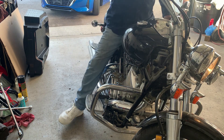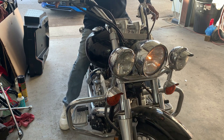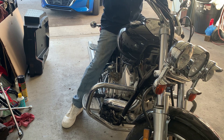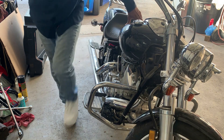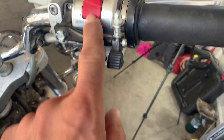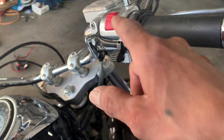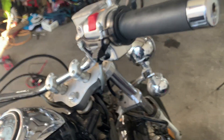I'm going to cut it off by putting it in gear. The reason I did that — I turned it off by just putting it in gear — is because I don't want to mess with this button. I think I'm having trouble with this kill switch or the start button; I'm pretty sure it's the kill switch. If it does it again, I'm going to have to open this up and clean that connection, because sometimes it's making contact and sometimes it's not.